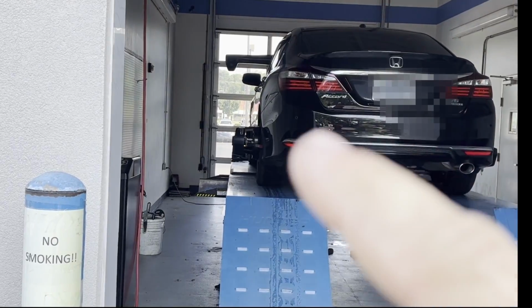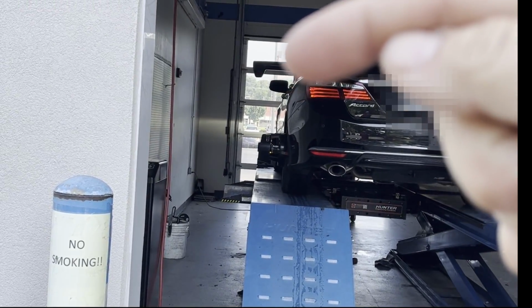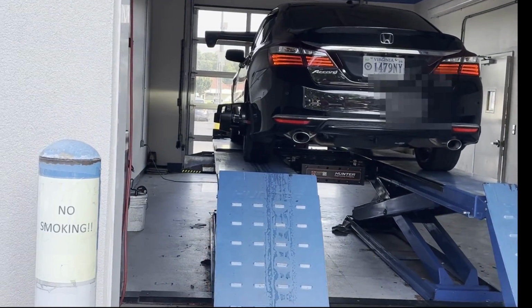And you see these little flashing lights here? Well, they actually read the sensors and it tells the computer where your alignment is. And then what the mechanic does, he dials it in by turning the tie rods, and that's how your alignment is done. And when you have an alignment done, make sure you get your printout.